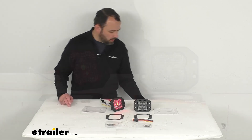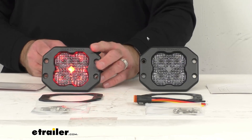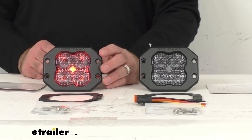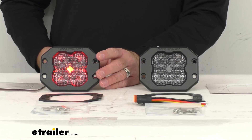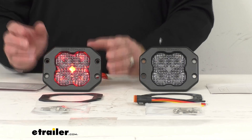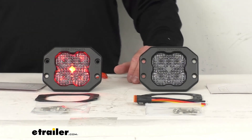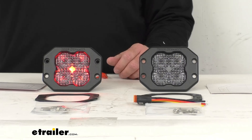Going back in for a close up view, I mentioned the candela rating — it's 1750 candela. In case you don't know, candela ratings measure the directional light output, and it's how anything is rated where you want light shining in a specific direction. Lumen ratings are just for omnidirectional output like your regular bulbs where you want light shining in all directions. For a more detailed description of these ratings, you can visit this product page on our website or Diode Dynamics provides additional information that you can find.